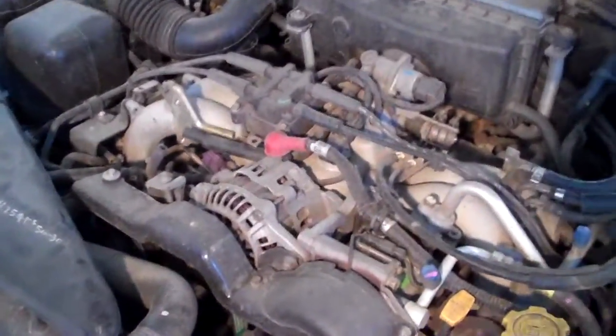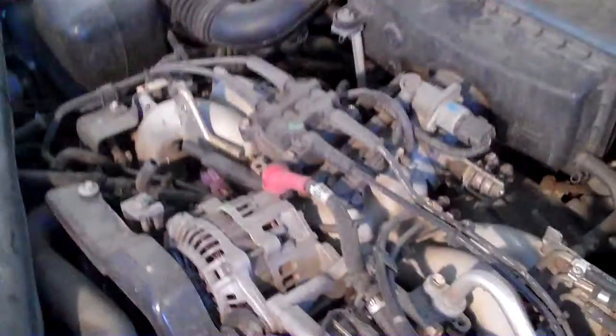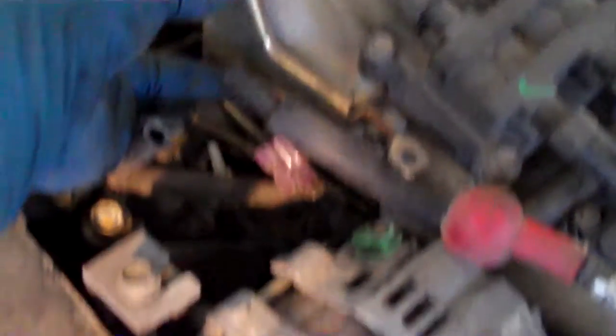Well, it's not an air pump. There are a lot of different designs for secondary air injection. This one introduces it through — this is your idle air control motor — and there's a line that goes down from that, under the ignition coil, and it goes to a little valve sitting right here.